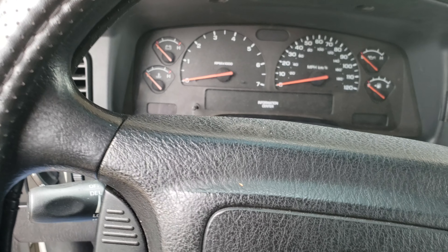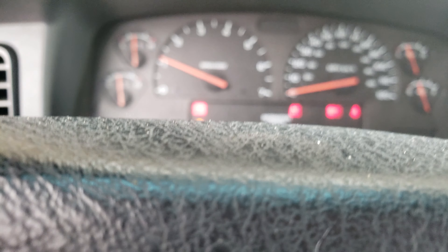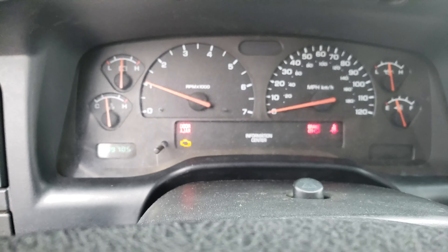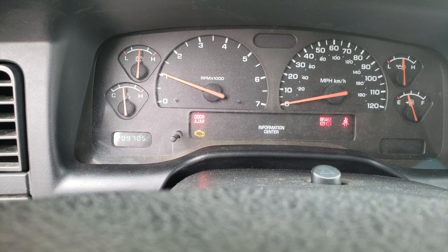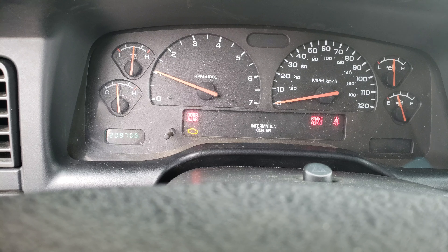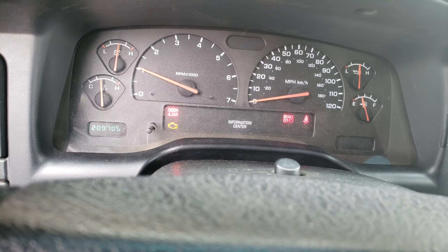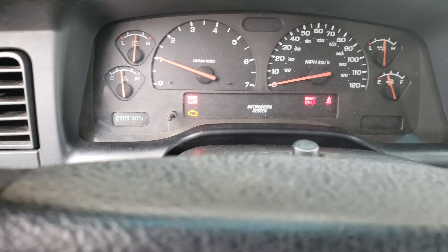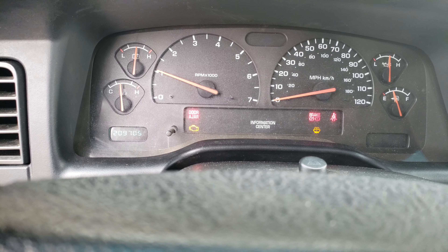She's just purring like a little kitten. So yeah, it's going to idle a little bit high. Normally it should idle at around 680 RPM. But since the TPS sensor's messed up, there's a fail feature that bumps the idle up a little bit higher, so it doesn't sit there and cam blow like one of those fake cam Mustangs where they pull the vacuum lines out. It would have been cool though — I'd like to hear it sound like it has a little bit of a lope to it. But it's whatever.